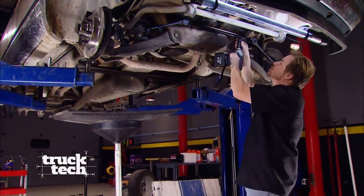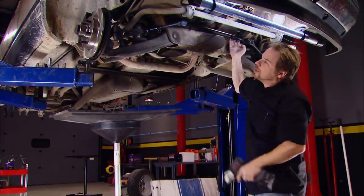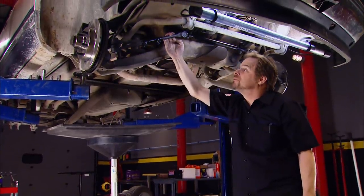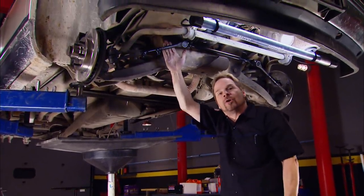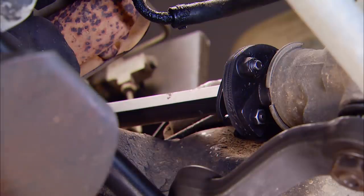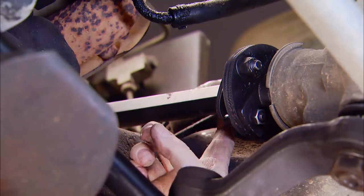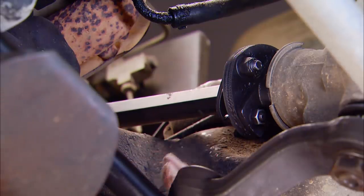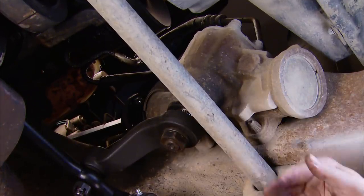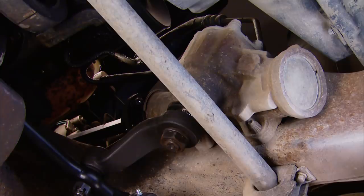Welcome back. The new steering linkage is back up in place and adjusted to just about exactly the same length as it was when we disassembled it, so it should be pretty good for a tow-and-go. Another thing that was causing sloppy steering and the wandering truck syndrome was the steering shaft rag joint right here — it was completely worn out. So we called up LMC and had them send us a replacement. That should just about take care of the steering. One thing we're not replacing is the steering box itself — since it wasn't leaking and it wasn't sloppy, it stays.